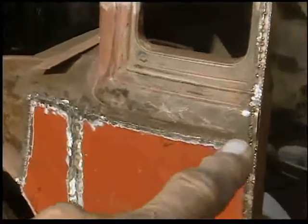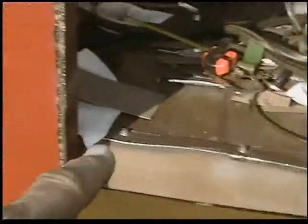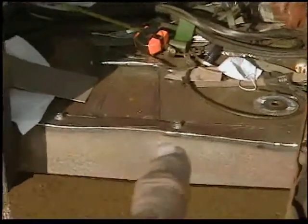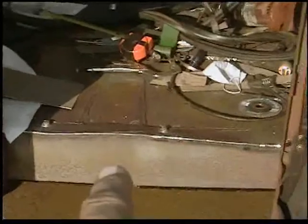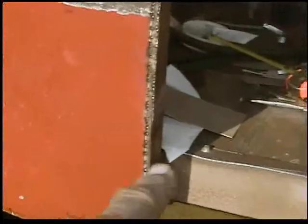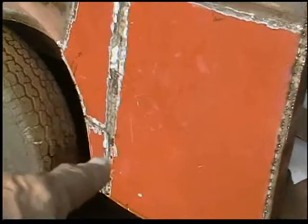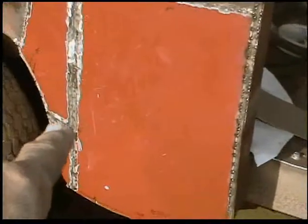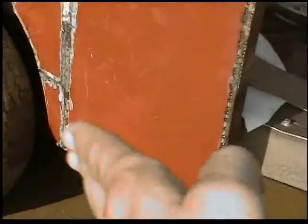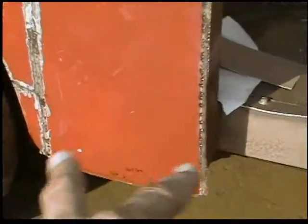Right now it's welded along the top and down to the rear wheel well. I don't have this panel here — this is actually the inner rocker panel. It's welded to the floor from the cowl all the way back to the fender well, but I don't have the right length yet. I don't have it going all the way back; it stops just short. So I've got to add a little piece to that panel back here.